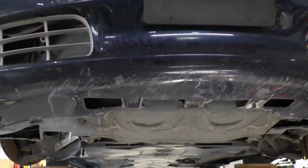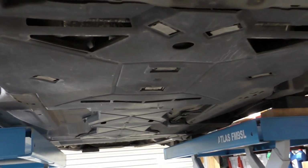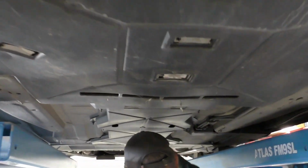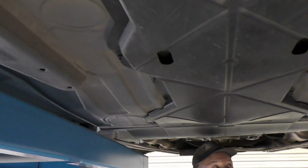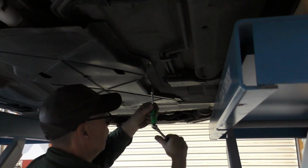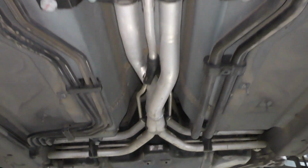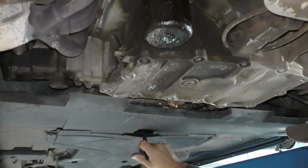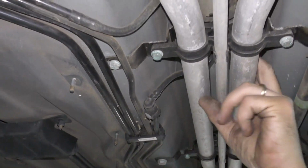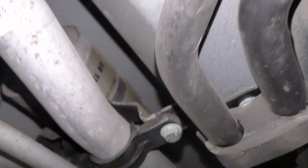When I'm underneath the car, most of the somewhat modern cars are going to have ground effects. These are plastic shields. When I'm looking at these, I'm looking at a couple of different things. Firstly, I'm just going to have a quick look over, see how secure they are, if anything's broken or falling off the car. But before I really go any further, I'm actually going to have to get these off to be able to see in. On the water-cooled cars, running down our tunnel right here, we have hoses that we need to look at. The fuel filter on a Boxster is going to be up in here, so I need to have all of these panels off. With the cover off, we can see our pipes, fuel filter buried up on top right here. So to access that, we would pull these down, move the pipes down.